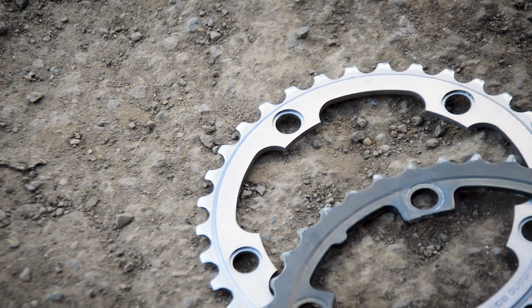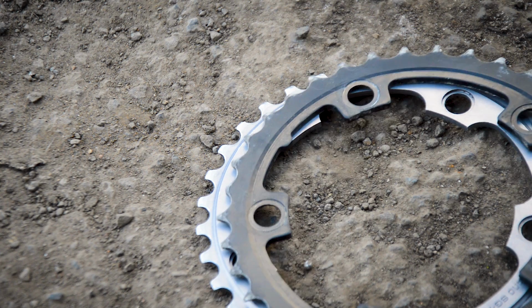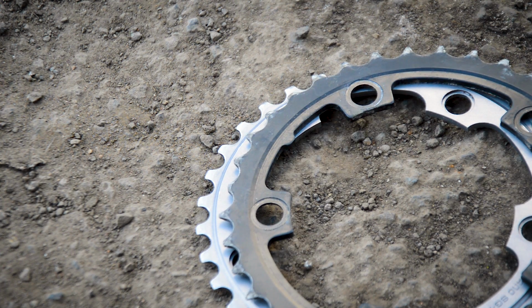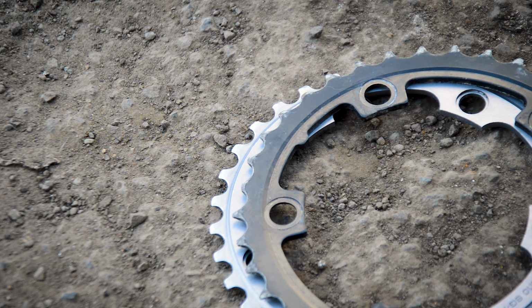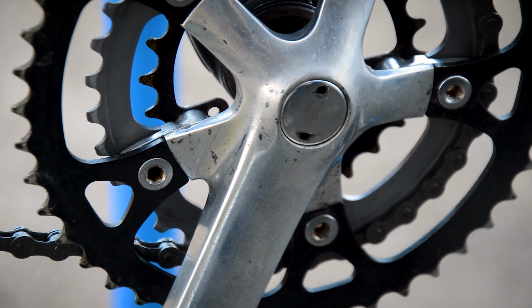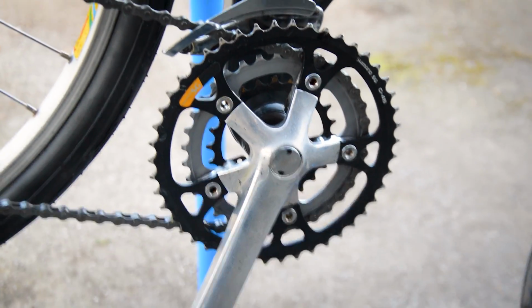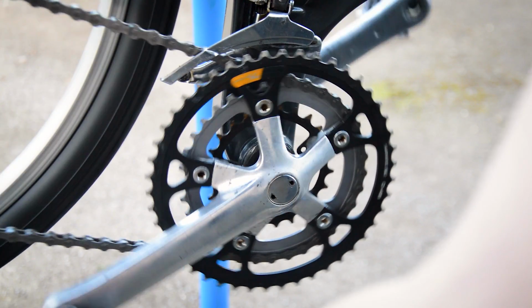It will definitely replace a bit more in shot, there. So you can see the difference in the rings for sure there. Yeah, so I'm going to just get that new ring on. Unfortunately it's not black, and then hopefully that should solve the issues, and hopefully you don't have to replace the big ring as well. Okay, silver ring is on. 9 speed / 10 speed ring is on. Question is, does it still shift? And then question is, does it ride?